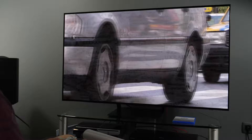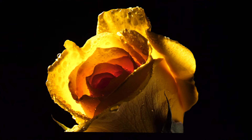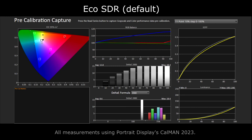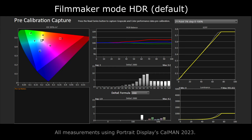Test videos used to check the dirty screen effect showed excellent results with no brightness variations across the screen. Together with high motion resolution, this makes the TV great for watching sports. This year Samsung added the ability to adjust tone mapping with two options: static and active. The static value performed really well, with content up to 10,000 nits displayed with many details in highlights and smooth gradations. The default picture mode this year is Eco due to energy regulations, but in terms of accuracy it is the same as the standard mode. The most accurate picture is achieved in movie and filmmaker mode for SDR and in filmmaker mode for HDR.